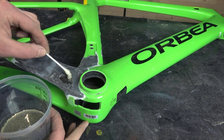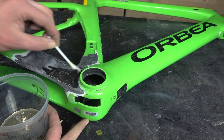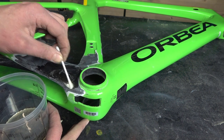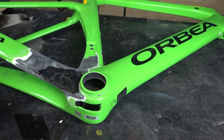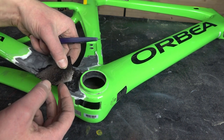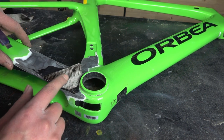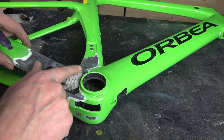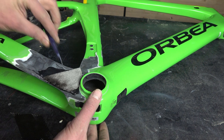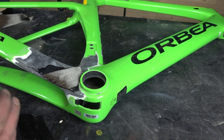At first I have to add some epoxy in this area. And I cut some pieces of this unidirectional carbon fiber, which fit this area. And we will do the cross layup, as I mentioned before. The first layer has this direction, and the next layer will have a cross direction. So I can produce such a crossed carbon fiber layup.